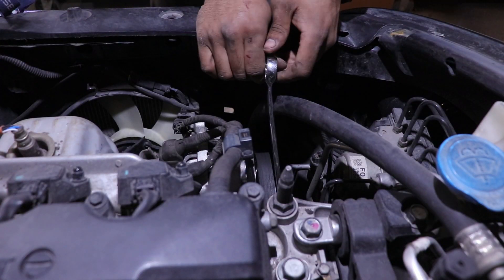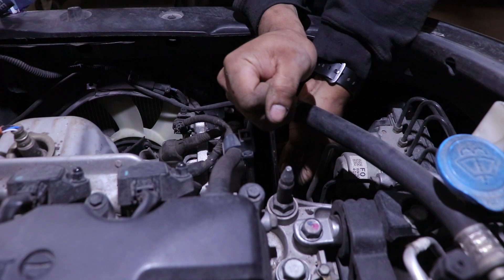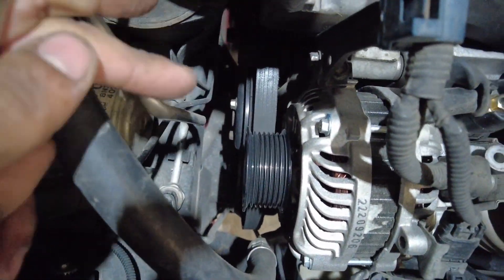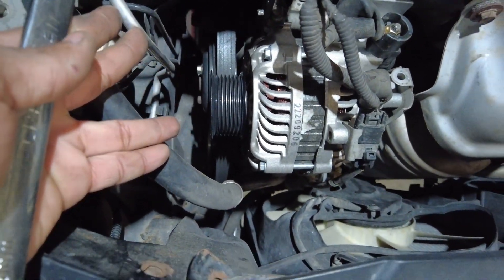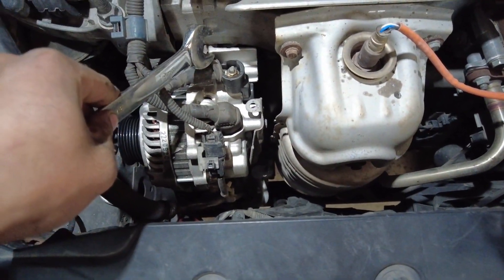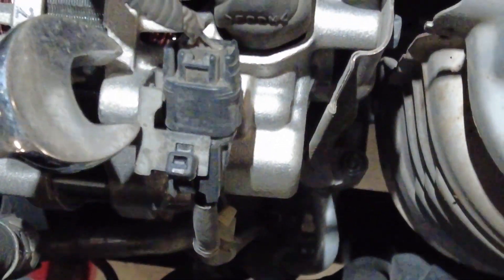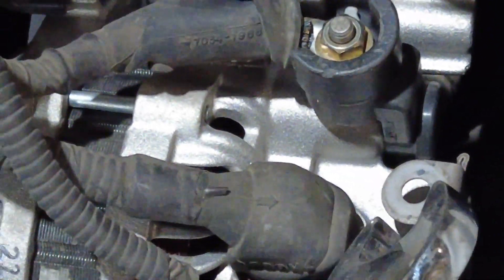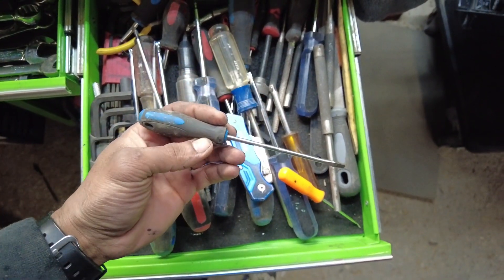I got the belt down — it's still in there. There's the belt right there, just flipped it over, and now my alternator is disconnected from the serpentine belt. Next up, we have some connectors: a 10 millimeter nut, a factory-style clip connector, and another clip connector under this rubber boot. The tab for it is in the front — you're going to need a flat-head screwdriver.